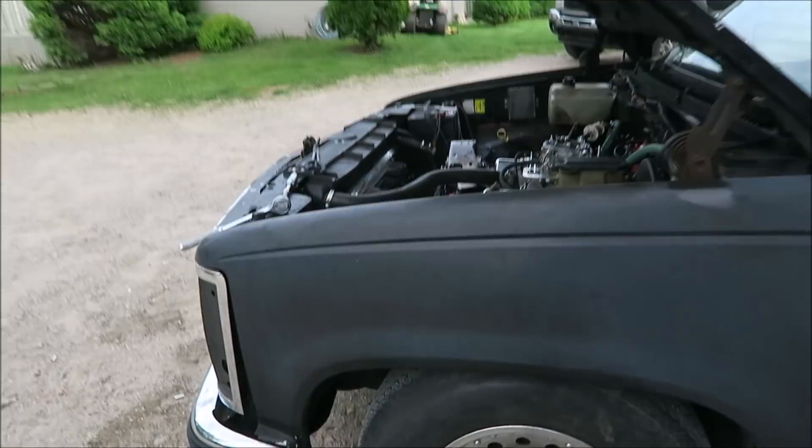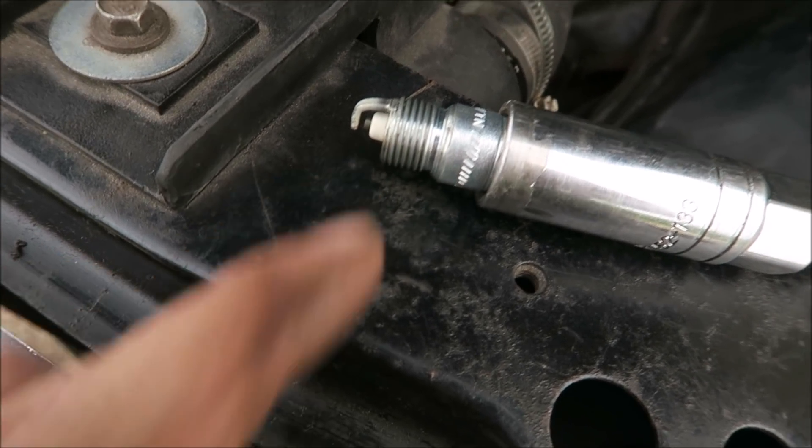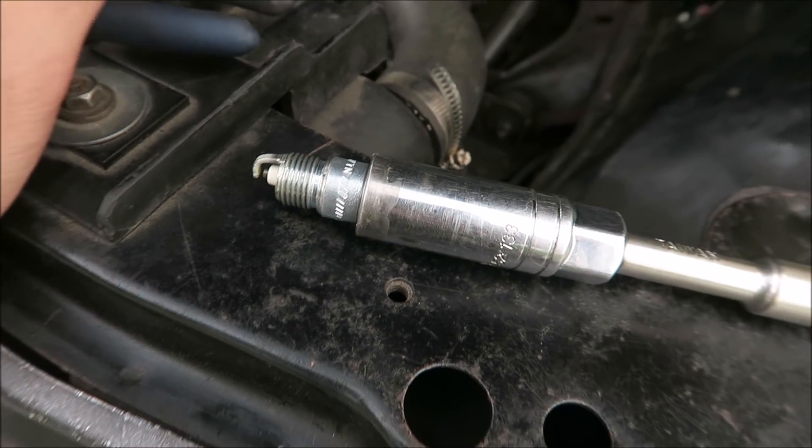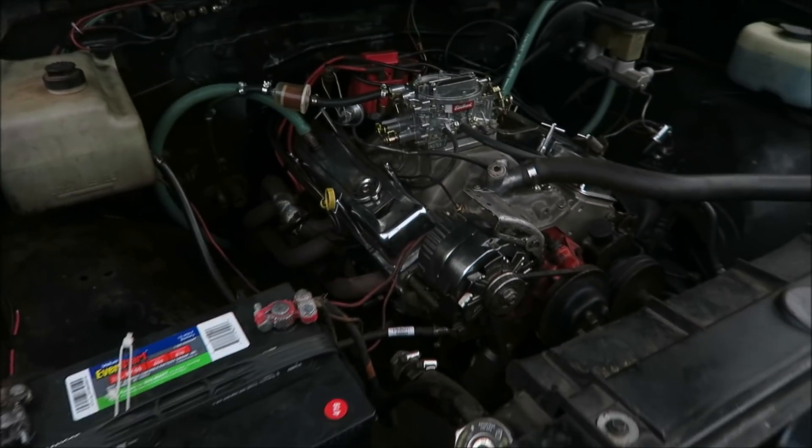Just got back and pulled the plug already. You can definitely see the discoloration down here. I think it could use a couple more degrees, and obviously we just have to throw some more fuel at it. The pull felt consistent, so I don't want to change too much at once — just throw some more jetting at it. I'm surprised it didn't have obviously pinging with that much timing. That's probably going to do it for today's video. Thank you for liking, commenting, and subscribing — we'll see you next time.